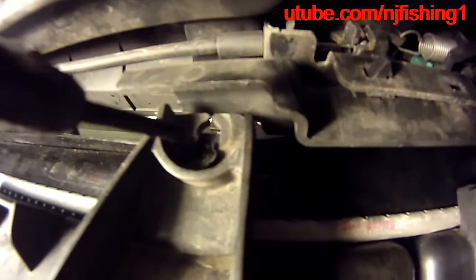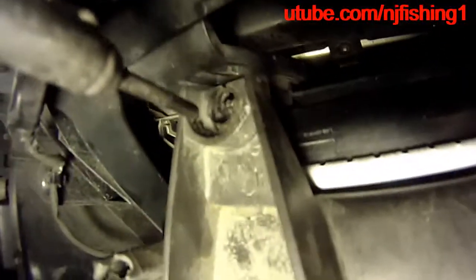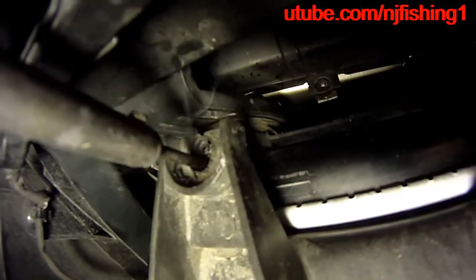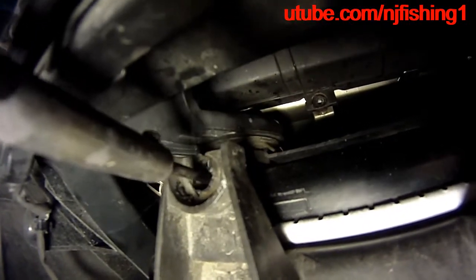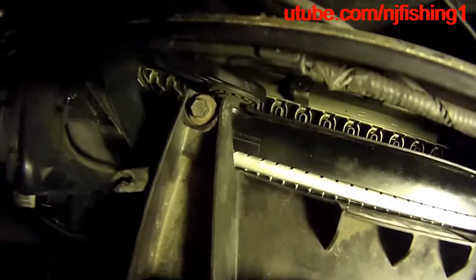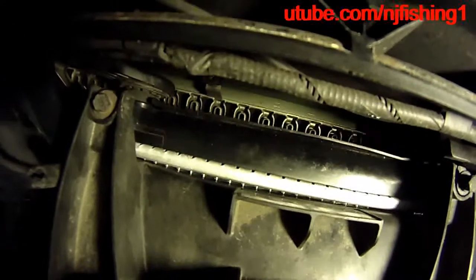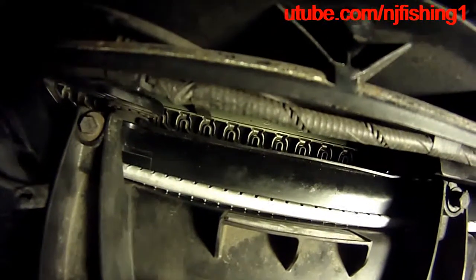It's hot, burning hot. Then same thing here, I just use the welding gun to get in there and melt those plastics so I can put the screws in there. That's how it's done. Screws on, and I'm going to tighten them down into the screw holes to finish installing the fan in the back of the coolant radiator.